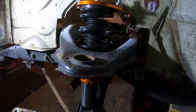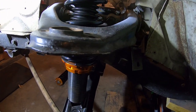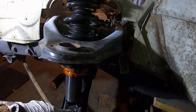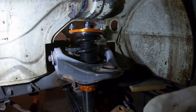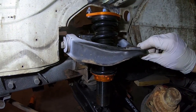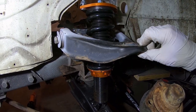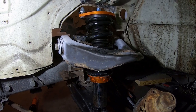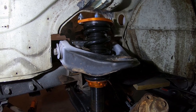I don't know if I should move the shock over about an inch. It doesn't match up at the top — it doesn't go straight up and down; it's offset. I may still be able to use the sway bar in the stock hole too. I'm just kind of shocked that the shock fits and I haven't removed anything yet on this side. These are bigger than the QA1 shocks I've seen people run on hard bodies and on 620s.